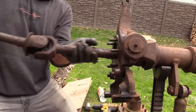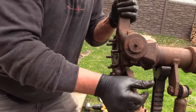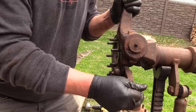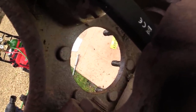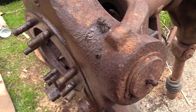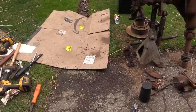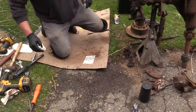Pull the axle - and this is the part I need. Now we can take the ball joints and separate those. Look how tight that is. Those are studs - you see the stud on the other side, it's got a cutout for the axle. Back in the day it was probably a very common part you could stock, not the case these days. I'll see if I can get one. I'm going to be doing wheel bearings too - wheel bearings are going to get replaced, rotors are going to get replaced.